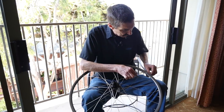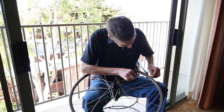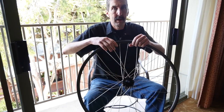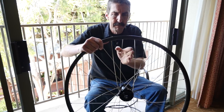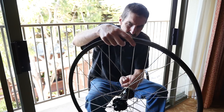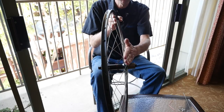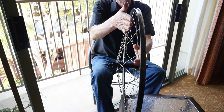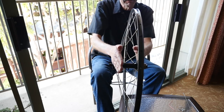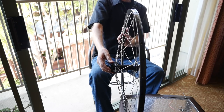I've got two more to go here — install and engage. Let's do a check. Here is the stem; I have parallelness. So we have every other one that looks good. Everything's crossed. We have the drive side here — it's going to have slightly shorter spokes. Actually, not so slight — these are longer spokes over here. That's going to be helping to give us dish. We're still going to have to have this tighter, but it's coming out pretty good.